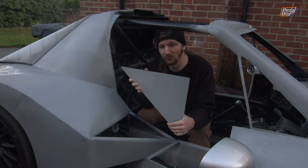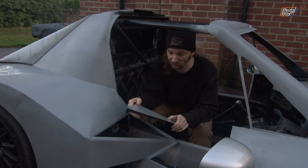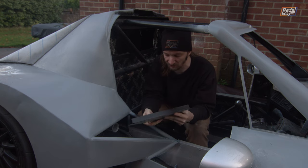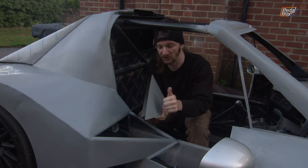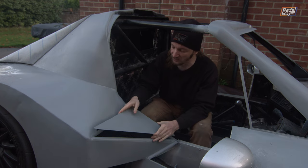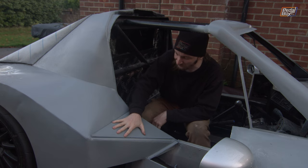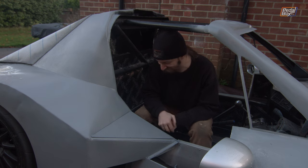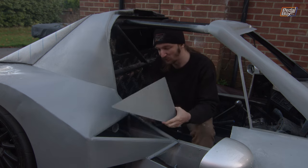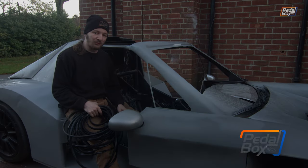It is now tomorrow and here is one of our completed access covers over the intercooler — it's looking pretty good. We didn't want to warp the panel because it's a nice flat piece here, so we've only spot welded it in a few places around the edge. To keep it sealed we've gone around it all with silicone and to dampen any vibration — we noticed that when we tapped on the edges it used to ring quite badly — we've also thrown a load of Dynamat on the inside using lots of little off-cut pieces. It's quite heavy with some good weight to it. So this is our first test fit since doing all the paint — it's actually really nice, I hoped it would be like that. And it pops out just like that, so we've got good access to our intercoolers and we'll be able to build and unbuild and rebuild our intake system nice and easily.